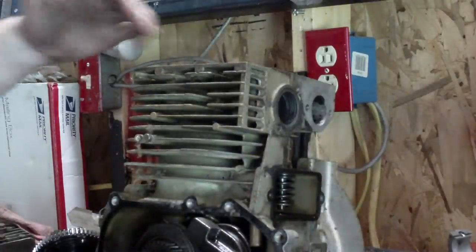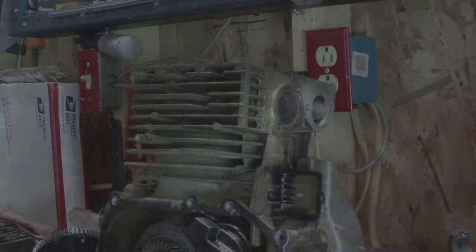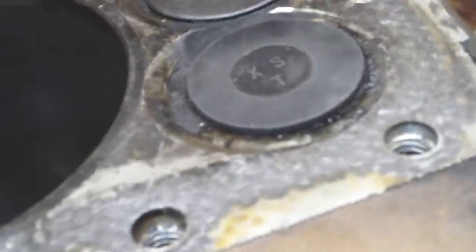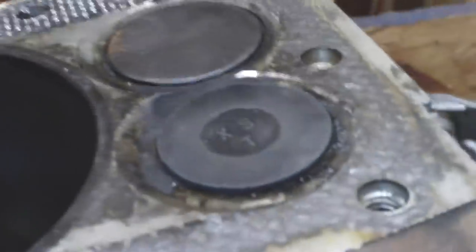This is a pretty smooth bore here. Here's a look inside the cylinder bore — you can see there's just a couple little tiny scratches. I can't even feel them with my finger. I'm going to hone it out and it'll be good to go. Here's a look at the valves. I can't really tell much yet. I hope the valve guides are good because I don't have any bushings. I'll probably just go with it like it is.